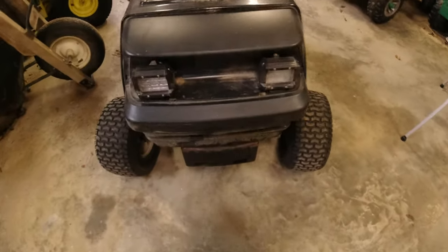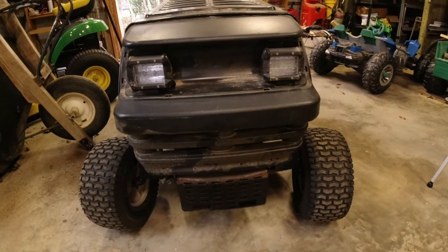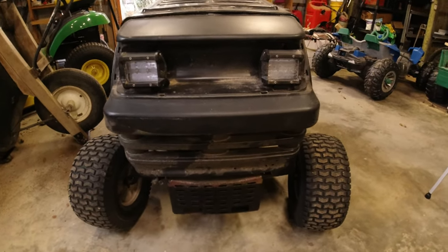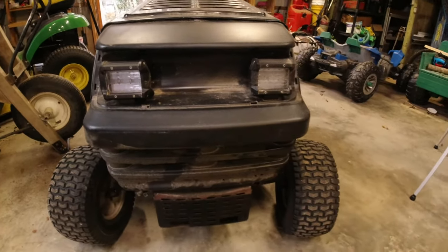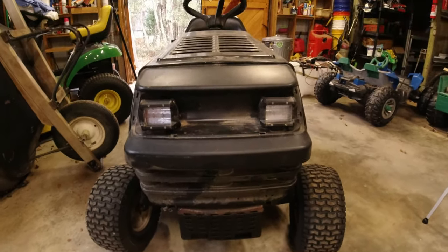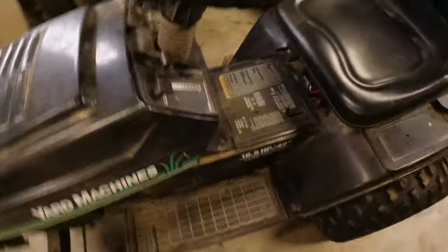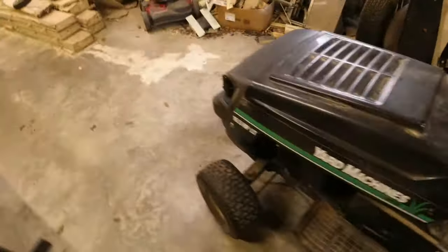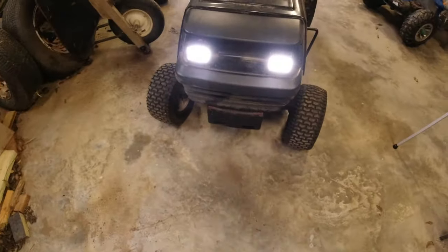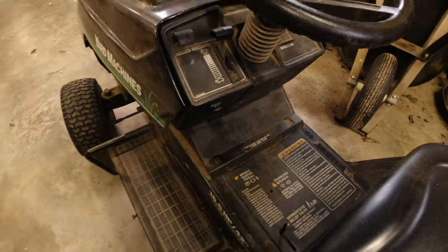After removing the deck I decided to put some lights on it. The original lights were incandescent and substandard. I went ahead and got these — just standard fog lights from Walmart, wired in per the directions, not much to it. I wired a switch here underneath. Turn it on and these lights give you a nice bright field of view, also much farther distance than the originals.